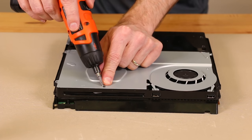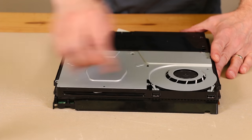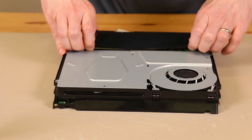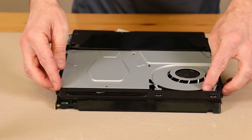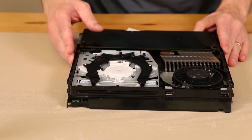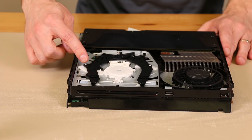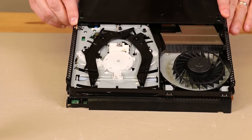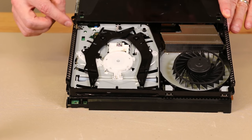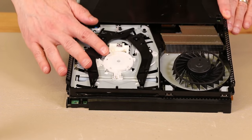Keep in mind the black screw goes right on the top front right here. Now that the screws are loose we can lift up on the plate just a little bit — a better place to be right here — and feel that it's nice and loose. So the next thing we want to do is lift up on the power supply on this edge and get it kind of loose, just about like that. Then we can lift up on the metal plate and pull it out. Now that we have that out, we get a view of the bottom of the disc drive. You can actually see the business card we put in right there. What we need to do here is first remove this little metal tab right here. A lot of times I get comments from people telling me they lost this metal piece or found this piece and don't know where it goes — it goes right here on the edge. So we're going to remove that first.